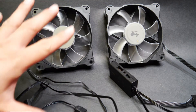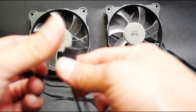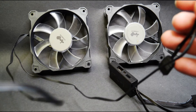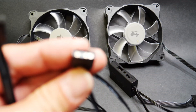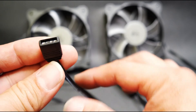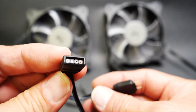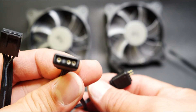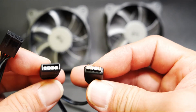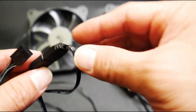There are two types of fans for InWin configurations. One type has a set of two cables coming out from them. One is the cable harness for daisy-chaining the RGBs — the first fan has this part plugged into your ARGB connection on your motherboard, and then it daisy-chains onto the rest of the fans. So this cable goes to the next fan, connects to it, and then the tail connects to the next fan, and so on.